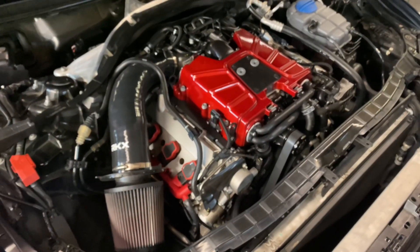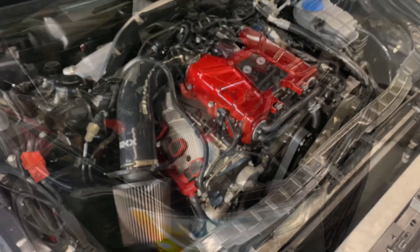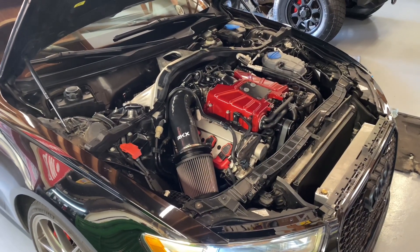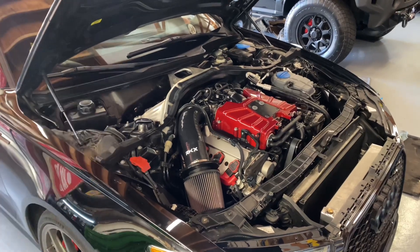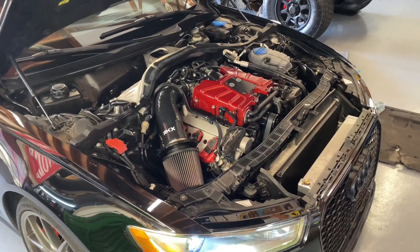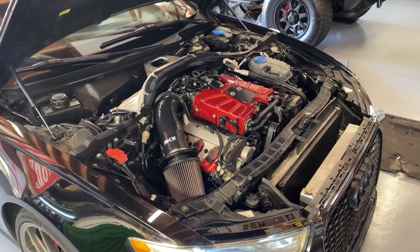He's also got 4OT stuff too, so if superchargers aren't your thing he's got you covered. We're in the process of letting the car run out of gas. All you have to do is pull the 25 amp fuse on the fuse box on the driver side, and pretty much at any moment the car will cut itself off. The car just cut itself off.